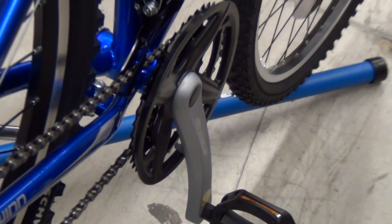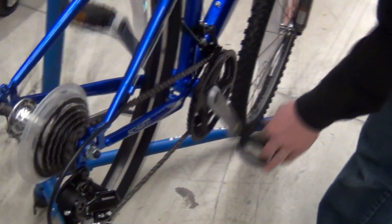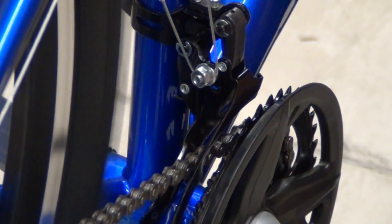We're just going to check to see how well this bike is built out of the box. By pedaling this bike, I can bring the shifter - as I tighten the shifter, it'll bring it up into the larger rings. I have full range of motion on the front shifter. What I'm looking for is to see if the chain is dropping off on either side, all the way on the outside or all the way on the inside, and I'm not getting any of that.